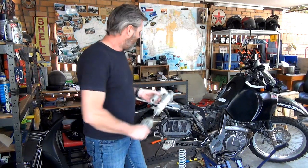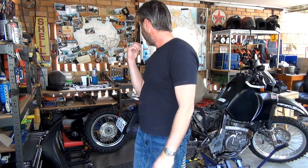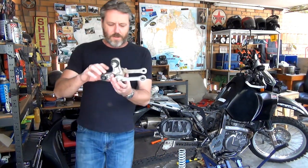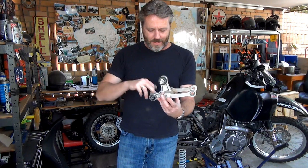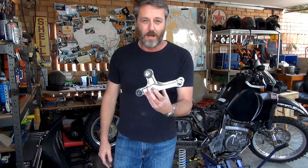Alright guys, so in the next video I'll do the, what do you call it? The swing arm, what do they call that bloody thing? The dog bones, the linkage, that's what it is. It's the goddamn linkage. So I'll take this bolt out, take these out, and re-grease it all and make it all look nice and pretty, hopefully.